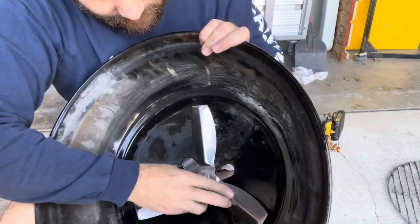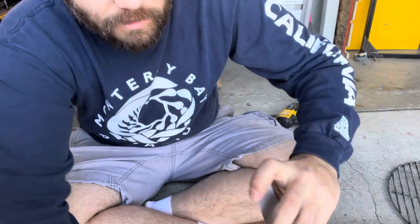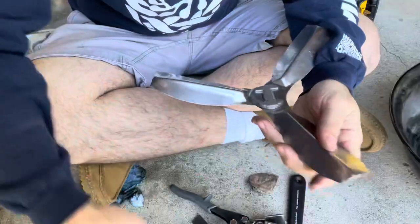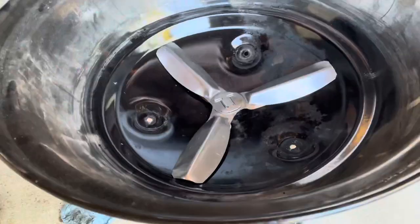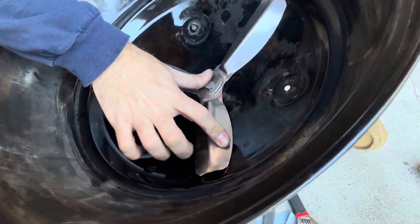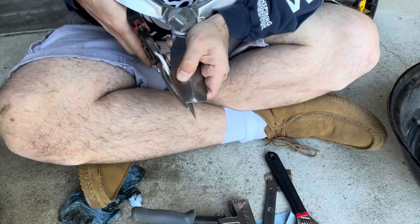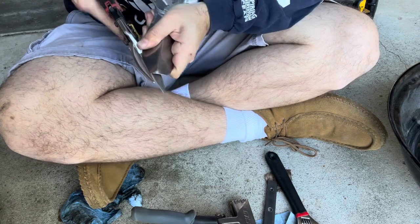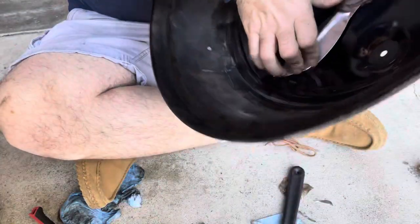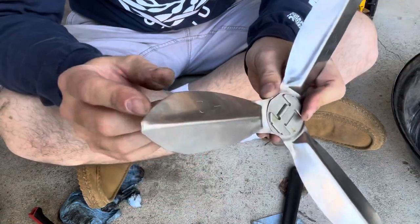Now placing it in here — it's actually matching pretty well. What I'm hoping to maintain is the ability to shut the vents all the way. After tweaking it a little bit, that's pretty soft metal but I'm getting pretty good contact. Leaf two right now is just almost perfect. I'm going to get a little bit more extreme on this and curve these around to see if I can get them closer to the original shape. I'm pretty happy with that — it turned out much better than I expected. I'll go ahead and do the same thing to each of the other corners.